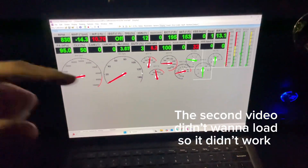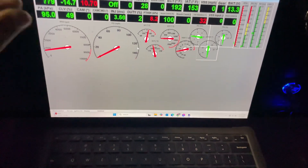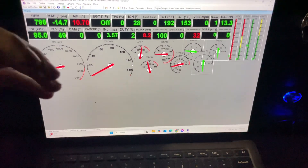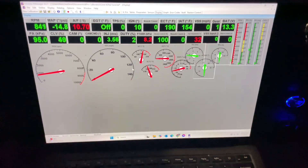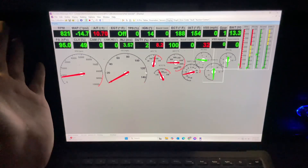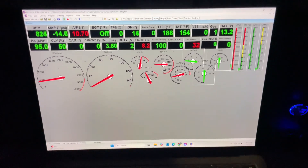As you saw in those videos, the first one was 6100 RPMs and the second one was 6200 RPMs. You could tell they're a little different — the 6200 didn't really want to activate because the ignition retard was set that way, so it didn't really kick into the two-step pop. The 6100 really worked. I had to cut it short because the phone fell — it's very windy with a big storm coming into the Midwest.